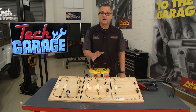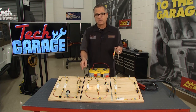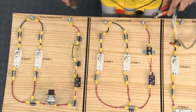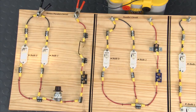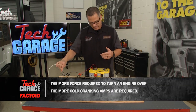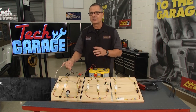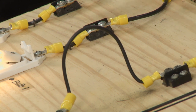Here's the example with the winch and why it's so important to keep that wire in good shape. This one here is a fusible link — just imagine this is the winch wire right here, and you go ahead and put a little wire in the middle of it. Not a good idea. That's a fusible link, that's designed to burn. But even on the winch, that's going to burn with enough amp flow. Our Optima here is pushing out 750 cold cranking amps — that's more than enough to do the job. Those amps are going to run so fast and so much that it's going to burn this link right in half. That's the weakest link, and I'll show you how that works.